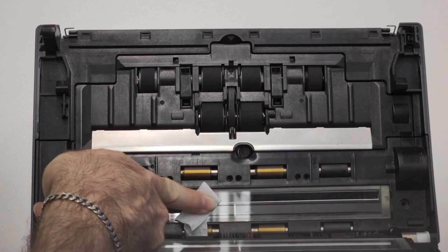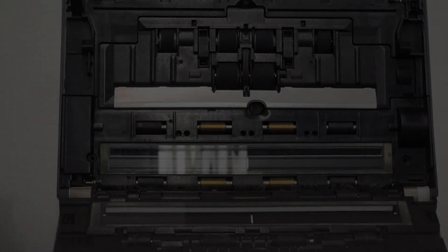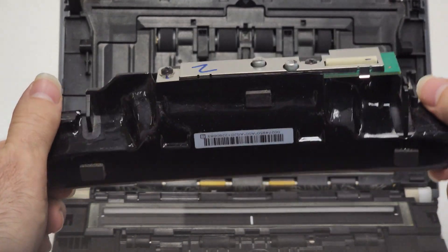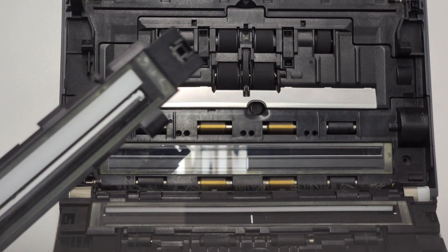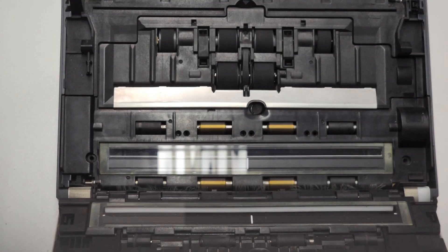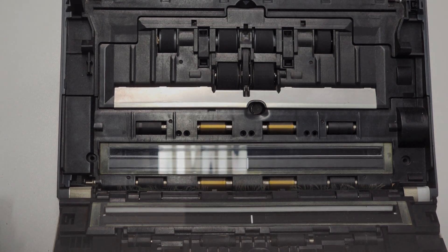Do not clean the inside of the unit with any harsh chemicals, as this will void the warranty. A special note on the AD240: the AD240 sheet-fed scanner's imaging units consist of a CCD, lens, and mirrors, unlike the AD345G and AD545GWN which use CIS technology. If lines appear on images from this model, or the output is dull or has a blue colour cast, it is recommended that the authorised distributor be contacted for cleaning of the optics.